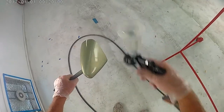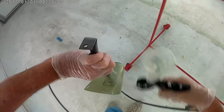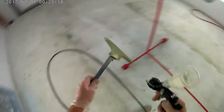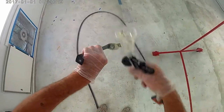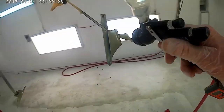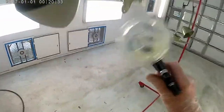Here I am putting on the first coat of clear. I'm going to put three coats of clear on these since I've got more than enough to do so. Normally on mirrors that I don't intend to polish, I just put two coats. On the first coat of clear, I'm not trying to get any clear coat inside the mirror cavity — I'll do that on the second and third coat.